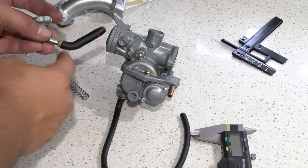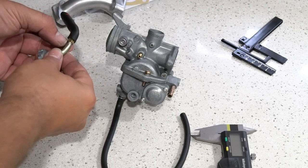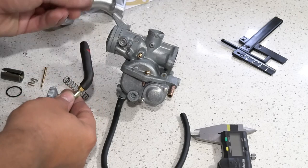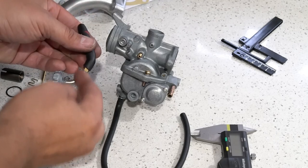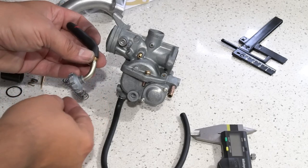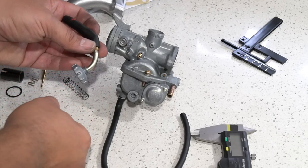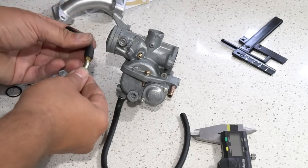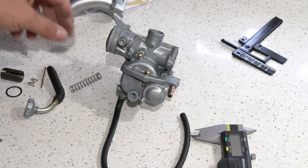All right, so with this being an adjustable nut on here, just leave the boot off, because you're going to slide that on the throttle cable first, and then you can still have this accessible to make your slight adjustments for free play on your throttle cable and slide. So no reason to push this boot all the way down on top of the cap.